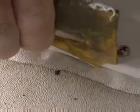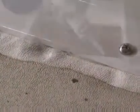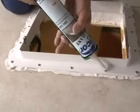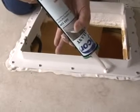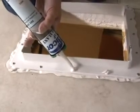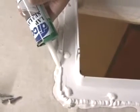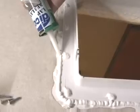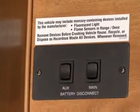After the roof flange has been installed, remove the excess butyl caulk that may have squeezed out. Using a sealer such as Dicor 501 LSW self-leveling lap sealant, apply a daub over every exposed screw head. In addition, apply a bead approximately 3/16 of an inch along the outside edge of the flange all the way around the vent.